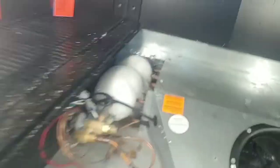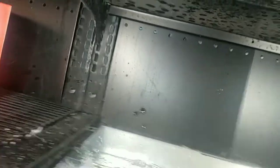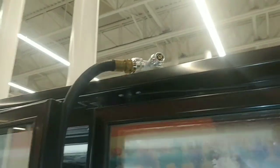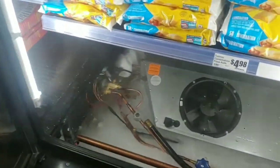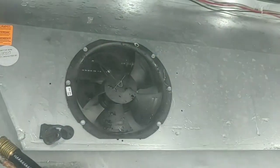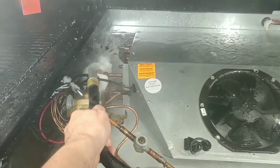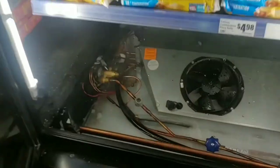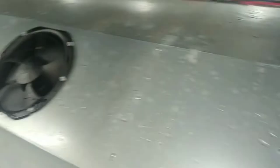Once I have the drain working, I start from the edge over here removing all the ice. You want to use hot water — unfortunately these stores have hot water right up here. It takes a good while to do this. Luckily this was just a plugged drain, but it takes a while to get all this ice out, then you gotta get all the ice behind there, then take the cover off. There's an air channel back there you gotta clear too — just patience and lots of hot water. It's as simple as that — pretty cool, just very time consuming.